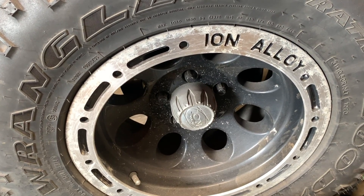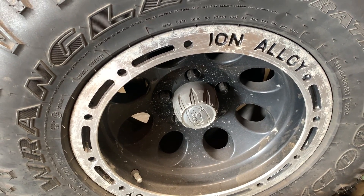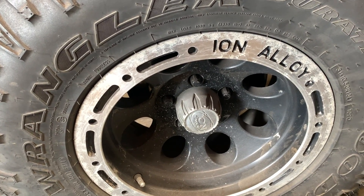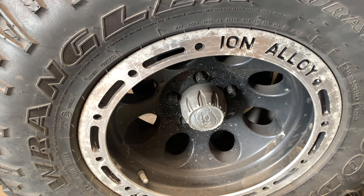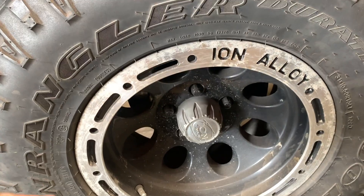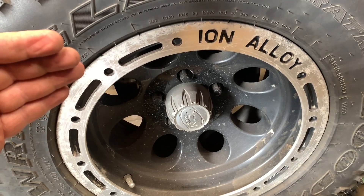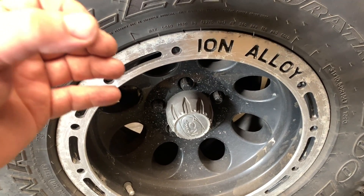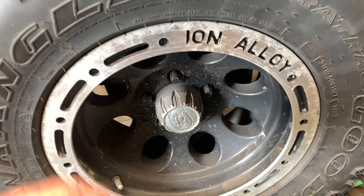This is especially important for driveshaft flanges. If you ever had to remove a seized driveshaft flange and you put anti-seize on it so that doesn't happen next time — what may happen down the road is the bolts will eventually become work-hardened or break off due to the torque being applied without the coefficient of friction. Same goes with your wheel: putting anti-seize between your wheel and the hub eliminates the coefficient of friction needed to prevent your lugs from shearing off and your tire coming off.